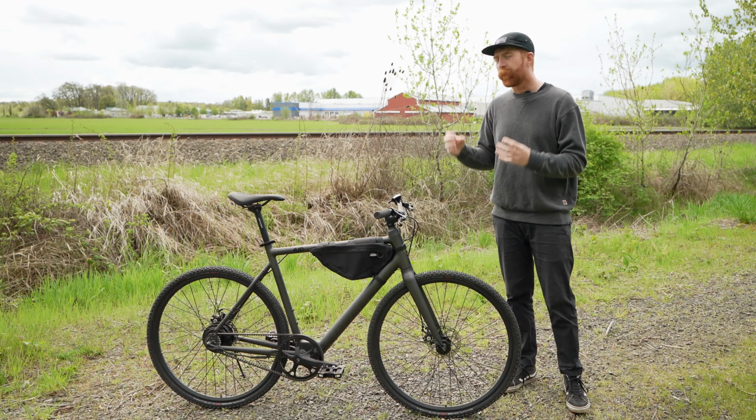Gates has a really cool app that when you remove the wheel, you have to loosen everything up, and therefore you lose your tension in the belt. So with their app, you can set it next to the belt, and as you adjust those chain tensioners to pull that wheel back in those dropouts, you can pluck the belt. It sends out a little decibel reading into the app and lets you get it into the right tension. So that way when you're pedaling, everything feels nice and tight and will get you on the road.